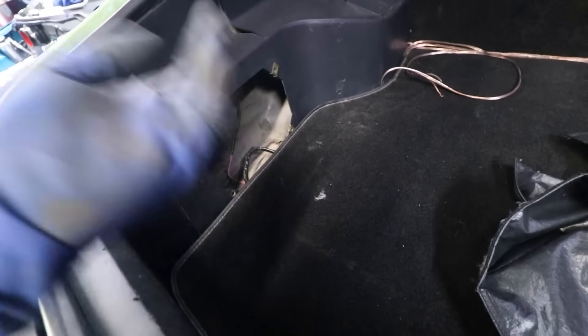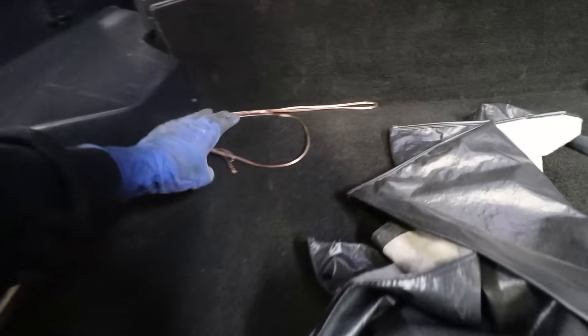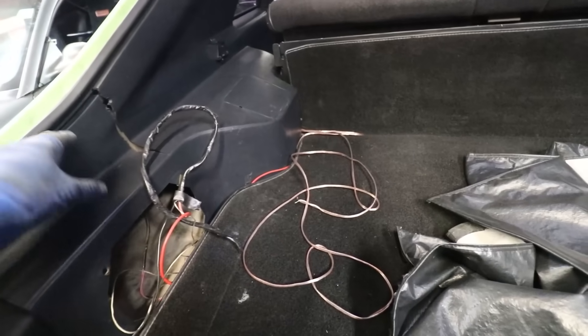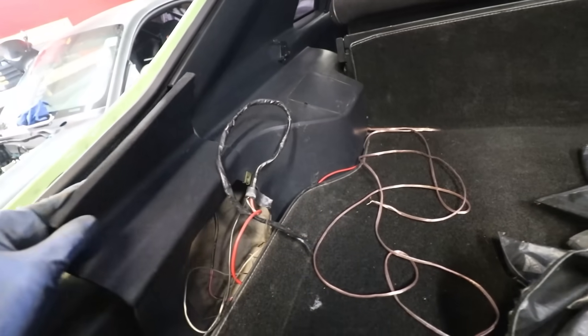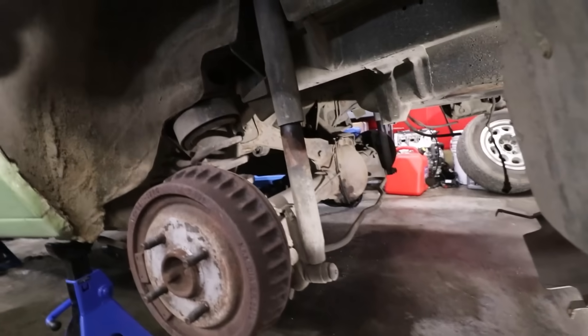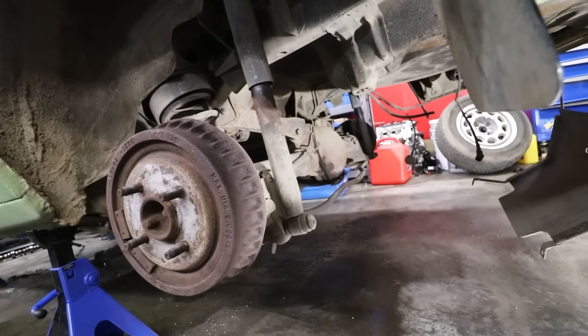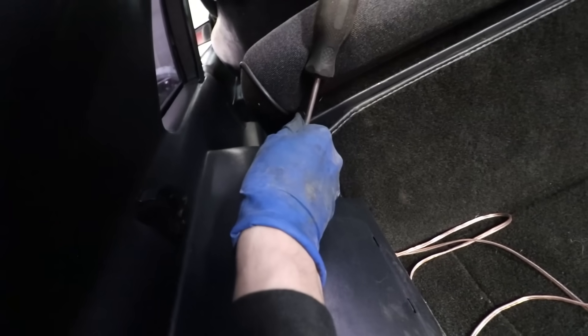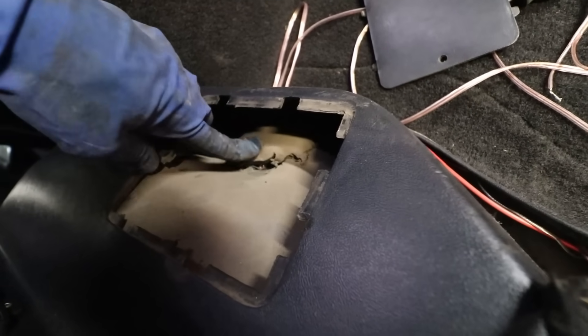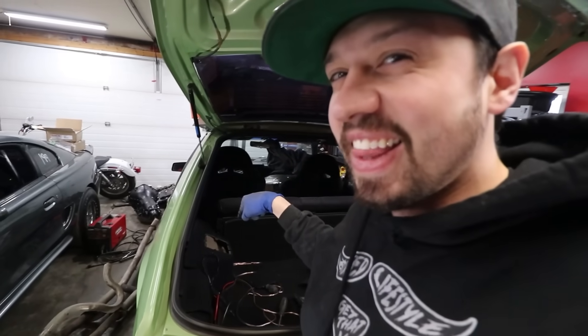What a shame - there's a speaker over here, none over here. Someone must have took it. Someone was like, hey, you can't have sound. What is this? I think we've got some wiring to do here, and this is cracked. We actually need to get to the shock mount bolts to get the shocks to drop down from here so we can start taking up the suspension over here. As you can see, the shocks kind of just hold it up. Springs fall out, and then it's the lower and upper control arms and then this should just drop out. I bet you it's conveniently underneath this little panel right here. I think someone's been in here before because they cut this piece out, which is like insulation. That's where a shock mount bolt is, so both of these have to come out.